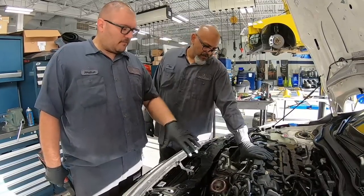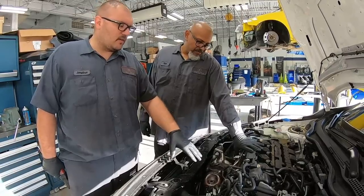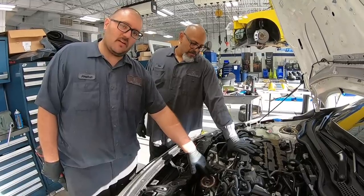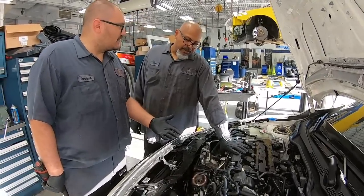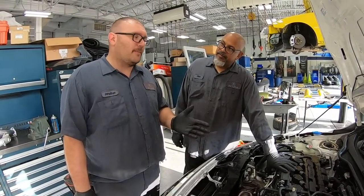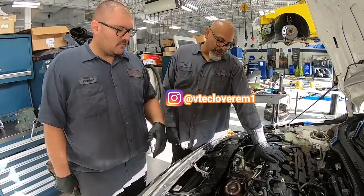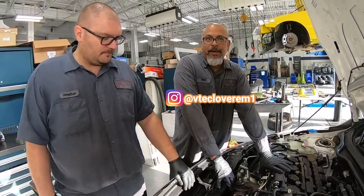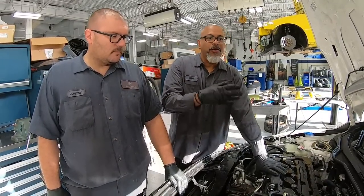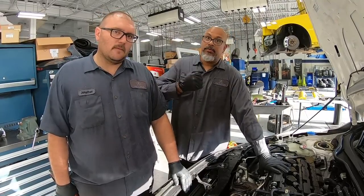When Miguel and I have run into this turbo setup on the RDXs and other Type Rs, we've run into a couple snags where these bolts lock onto the studs and eventually snap off. We've developed something that is not foolproof, but tends to help a little bit. We like to soak these, crack them a little bit, work the bolts back and forth, and let it sit overnight, soaking as long as you can. It seems to help get that bolt loosened up some.